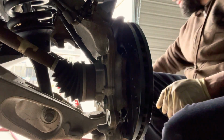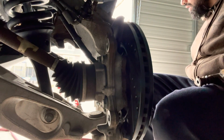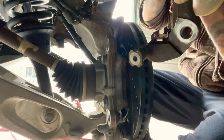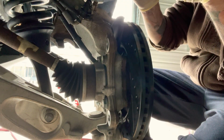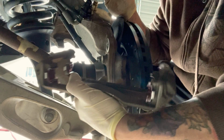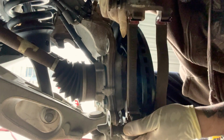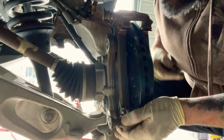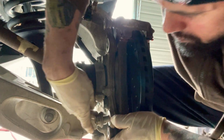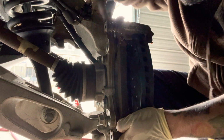And then we're gonna lubricate the slides with some grease where the pads have contact, so that it doesn't get corroded. So you want to put some grease on there, and then we're gonna do the slides once everything's on. Put in the 2 bolts to hold this. Can't find a hole. There it is. The hole.